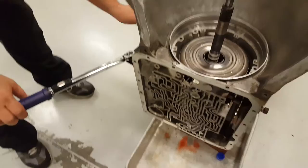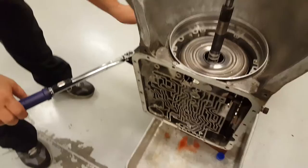Now, so we're pretty close to the right length on the piston pin. If when you go to torque it and it torques down and clicks and you don't see the line, then your piston pin is too long. What that's going to do is it's going to basically engage a 2-4 band all the time, which is going to burn it up.